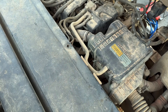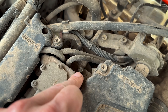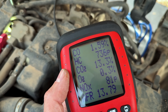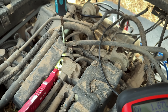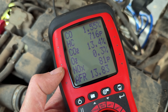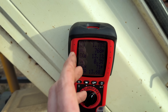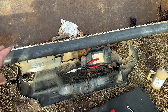Our CO is going higher, so we'll have to make a little adjustment on the carb. The adjusting screw is right here - made a slight adjustment and we're coming back down to specifications. CO should be 1.5 plus or minus 0.5, so up to 2%, and hydrocarbons below 1,000 parts per million. Quick correction: the engine speed adjustment is this one, and this one is for the fuel and hydrocarbons - I had that backwards earlier. It takes about five minutes for an accurate tailpipe reading to stabilize. Our air fuel ratio is coming up closer to 14 - we're stabilized now around 1.7 to 1.9, with 769 hydrocarbon parts per million - in specification per the factory service manual.